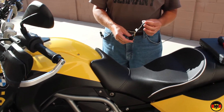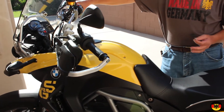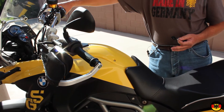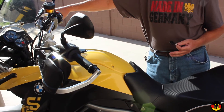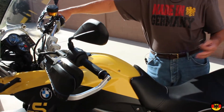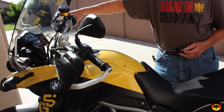The problem on this bike is that when you're driving it, about six minutes into your journey, the ECU suddenly updates with the outside temperature and it starts kicking and bucking and stalling and spitting and falling over and dying, and you have to get out and push it.